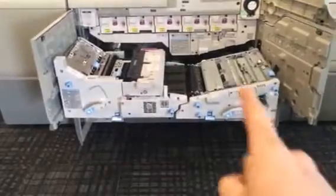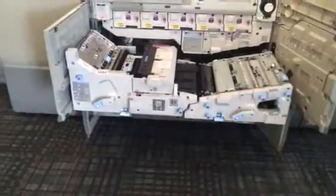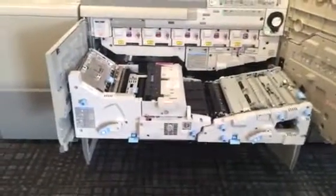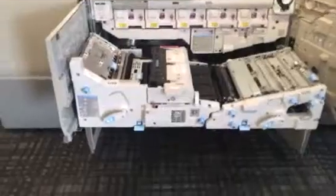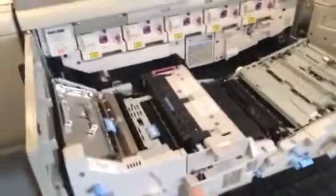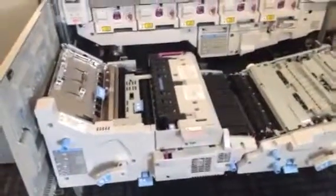Because sometimes what happens is the lead edge of the sheet hits the fuser. Sometimes it can stutter as the image is being transferred onto the sheet at the tail end. So having that length is very robust, and it's all stainless steel, and it doesn't slow down. So that's the reason why that fuser is very robust. It'll do 360 GSM at only 15% off its full rated speed of 80 pages per minute. It runs up to 300 GSM at full rated speeds.